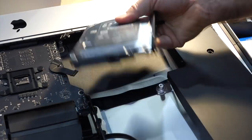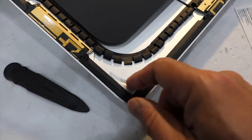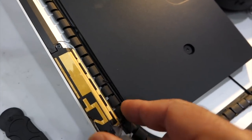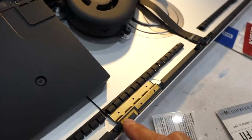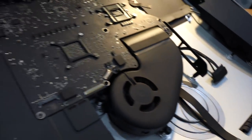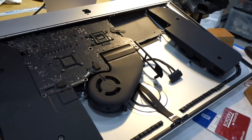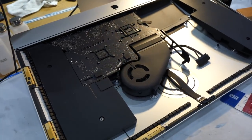Here's the hard drive — they had to machine a little groove in the back so they can actually fit the screen in. The cables are all tucked in perfectly. These are the antenna cables — you can see the micro coax. It's beautifully done and it doesn't cost you much more than a PC. I'm fairly impressed, actually. Except that if it breaks, it's non-standard — it's optimized too much, and Apple doesn't help much. But except from that, it's really beautiful hardware that could belong in my collection — I wouldn't mind.